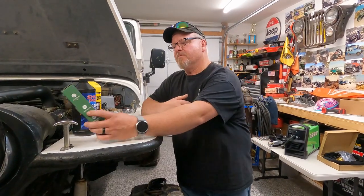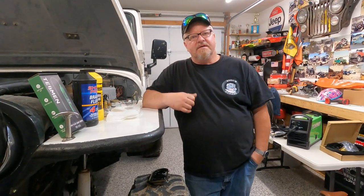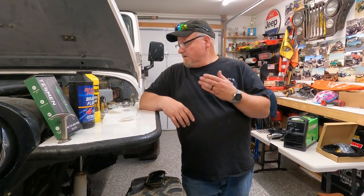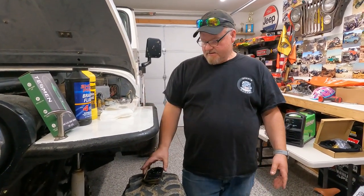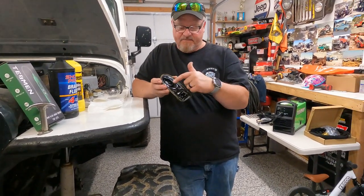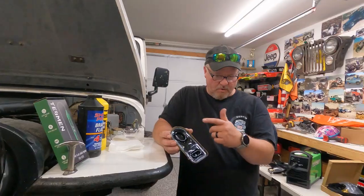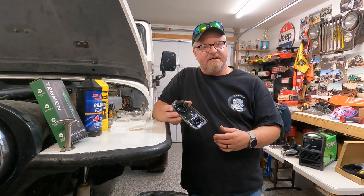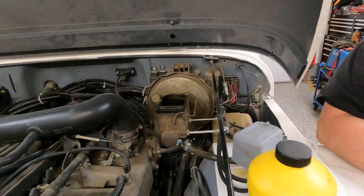So what's wrong with your brake fluid and how can it go bad? Most brake fluid — DOT 3 and DOT 4 — is hygroscopic, meaning it will absorb moisture from the air. Isn't my brake system sealed? Kinda. Most brake systems are sealed with a lid like this, but they only seal with a gasket. Over time, oil and other stuff eats into the rubber, it gets hard, and it lets air into the system, exposing your brake fluid to moisture.